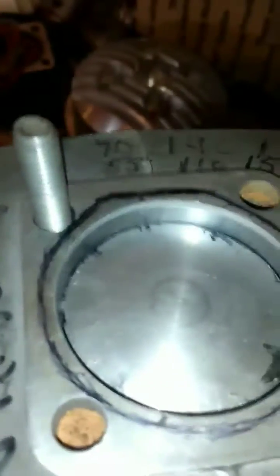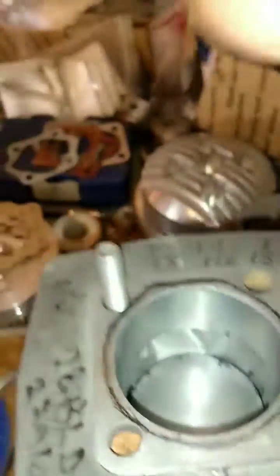You never want your crankcase open to the atmosphere. I hope this helps — it's just a mock-up of your scenario. What I think you got going on is it's bothering you that your piston is going below the port. No big deal, man. The reason why that happens is sometimes on them compact motors, your skirt has to be short so it doesn't hit the crank at BDC.